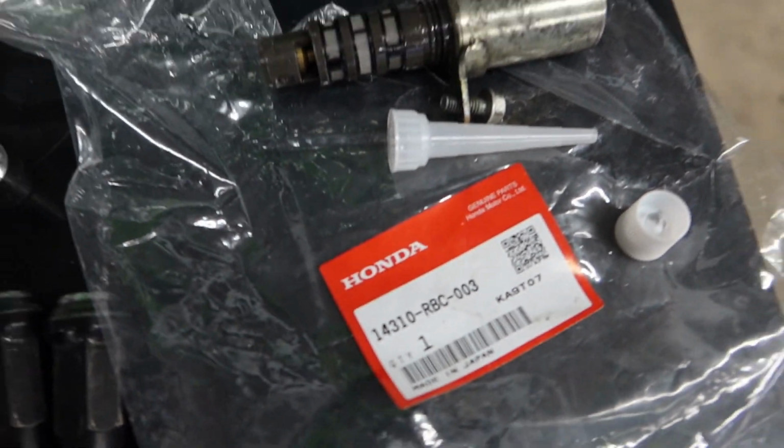If the G7 will focus. There you go, from Honda. Roman's over here with the RTV, doing what he does best with actual Honda bond. So we shouldn't have any leaks once we get this back together. We just did the timing, swapped the cam gear. We were having issues with injectors. We swapped some stuff around, got that fixed. It was running on 3 cylinders.